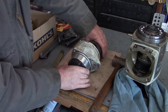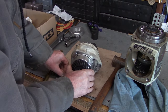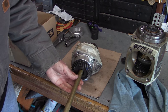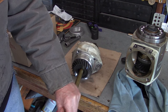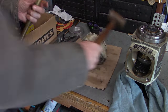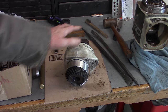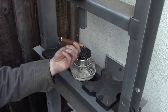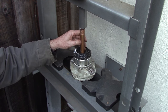While it's still warm, use a brass punch — you usually have to tap the u-joint assembly out. This one's being stubborn, so I'm going to put it in the press and press it out. I've got a piece of heavy copper pipe; this should work nicely.